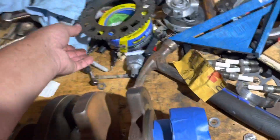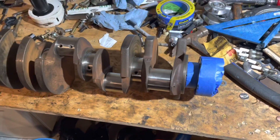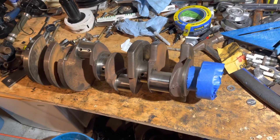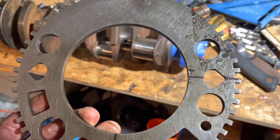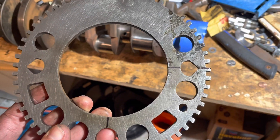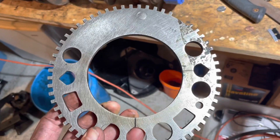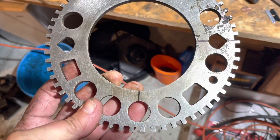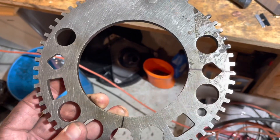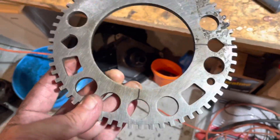I'm now about to mount this 58-tooth trigger wheel. What I'm going to do is stand the crankshaft upright and have my shop assistant hold it vertical. I'm going to heat this trigger wheel up using vice grips on either side to approximately 500-550 degrees. Hopefully it'll expand and I can lower it right onto the crank, and when it cools it'll be mounted. I'm going to have to eyeball the alignment with the black marks I've made. I put another mark on the front so I can line it up while holding both sides.